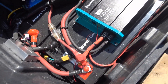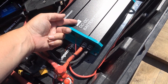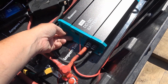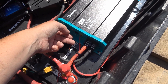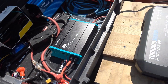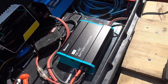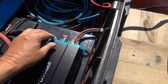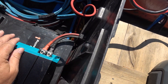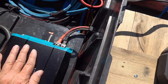There's also a trigger wire here - you can see this red wire. To turn the DC-to-DC charger on and off so I don't run my batteries down, it goes into the cab. I've mounted a switch near my seat. There's also a fuse to protect this wire - about a 2-amp fuse. Now for the DC input, right here I've got a connector they use in semi trucks - it's about a 100-amp waterproof plug. I drilled a hole in the box and mounted it, and that's the input that's going to come from the alternator.